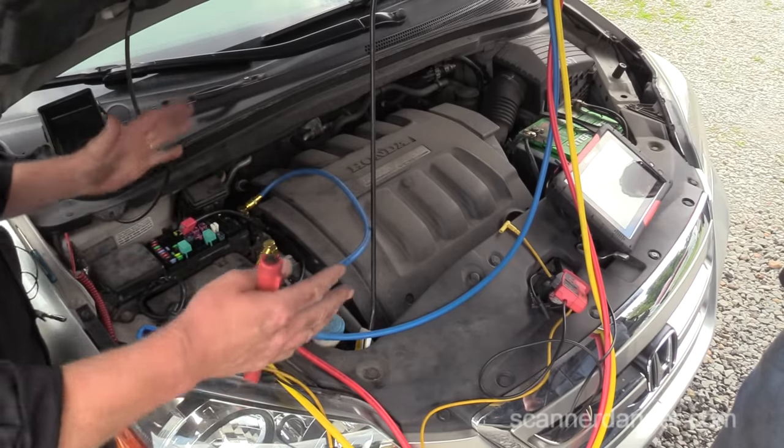Now I'm on the bottom side of this connector. This will address that connector and whether or not it is intact. Tim, can you flip that switch on and off a couple times? Wiring is good all the way down here. The last piece would be to grab that ground wire up top and get a reading, but everything else is good. At this point, just tug on the wiring to make sure you can't pull it apart — and if you cannot, that's confirmed faulty clutch. It's an open in this coil for the AC clutch.